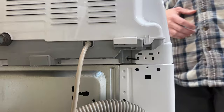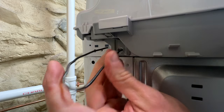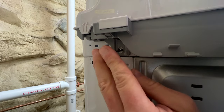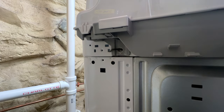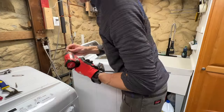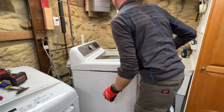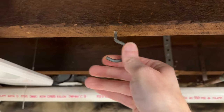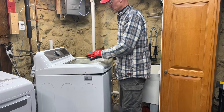I'm using scrap pieces of 14 gauge Romex. Thread one piece of wire into each of the screw holes and their adjacent holes — they're going to be twisted together to prevent the cover from sliding off the back and stressing out that wire and tube. I prefer using Romex wire because it's strong, pliable, and the insulation prevents scratching the paint, but any strong wire will work. At this point, make any final preparations so the top cover can be propped open. Our basement ceiling isn't finished so I installed a ceiling hook, but if yours is finished you may need to secure the cover from the back or sides. You could also just get a helper.